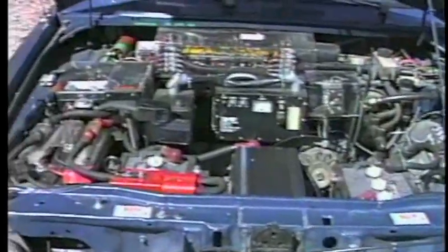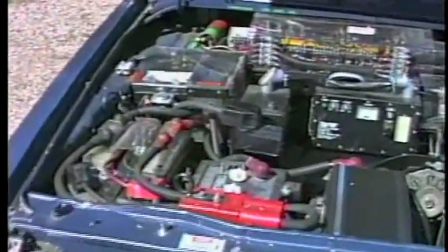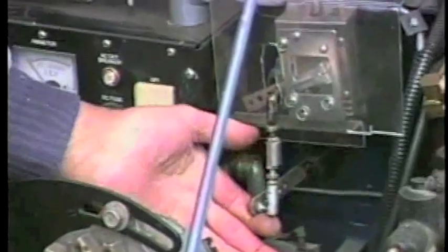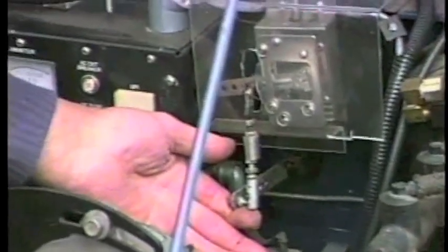The DC motor mounts in the regular engine compartment along with two 6-volt batteries. The 12-volt battery remains on board to power accessories and the dashboard motor controls. Also under the hood are the alternator and the rheostat, which is actually the throttle — put your foot on it and it runs the motor.